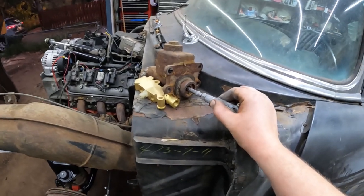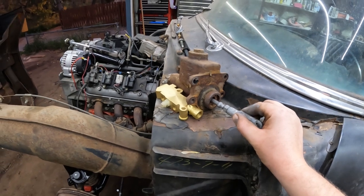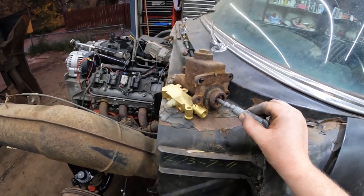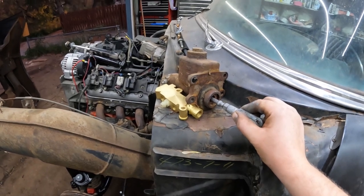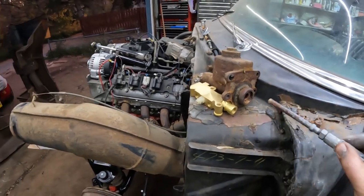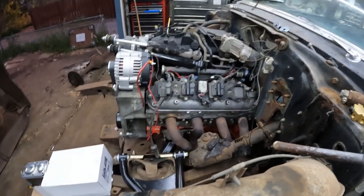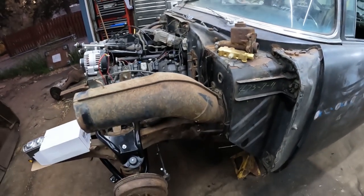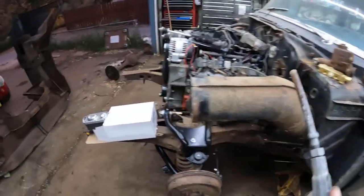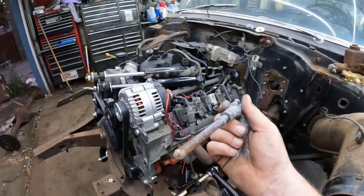Now you don't want any pressure on this cylinder in there, not at all. You want it to be out just a little bit. So when you step on the brake pedal, you're going to make contact with the cylinder before it starts pushing. Otherwise, if it has just a little bit of resistance, it'll hold pressure in the system slowly but surely. Your front brakes will lock up, you're doing burnouts, you're roasting the transmission. It's not good.